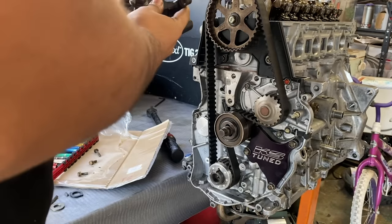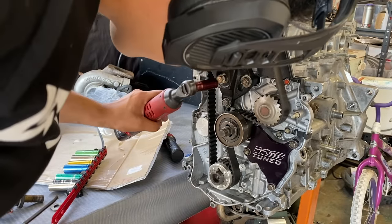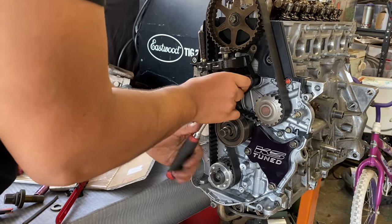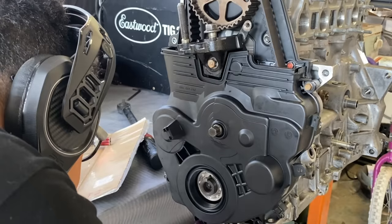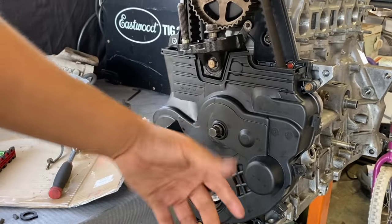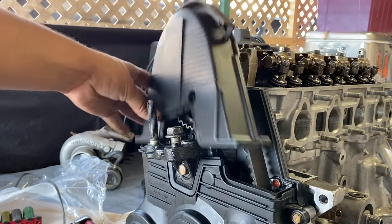Motor mount. So I'm only gonna put those three bolts because I remember when I was trying to take the head off, I could not get these off. Yeah, I'm gonna future-proof it by not adding these. I don't think it's too important. I've seen people even run without these, so it makes me feel more comfortable just having three bolts. All right, cool. Now the only thing left is this cover, but something tells me to do it later.